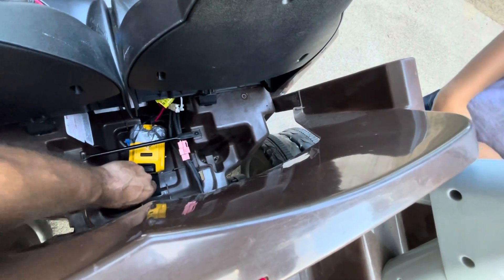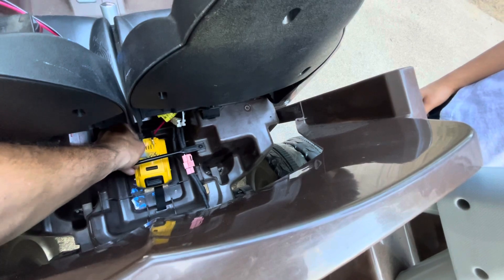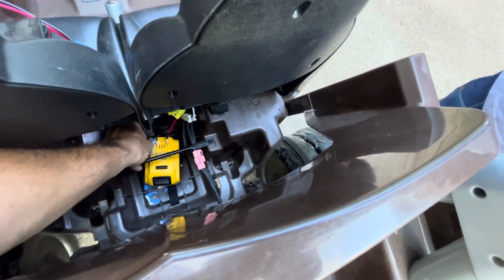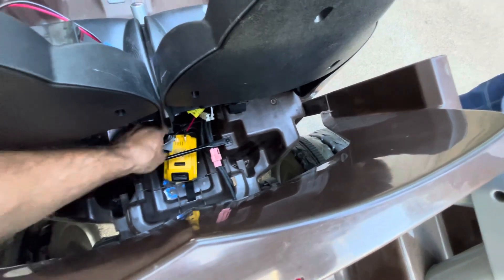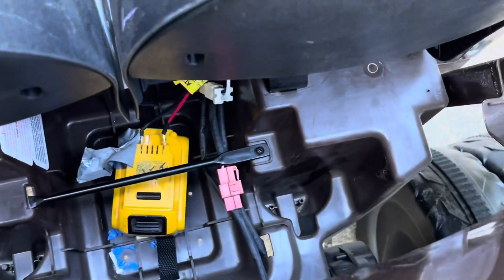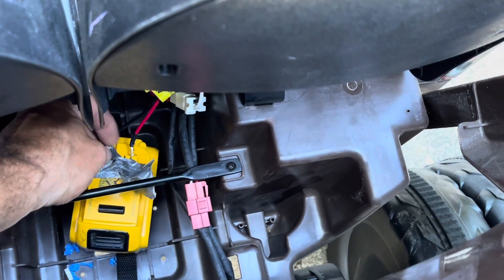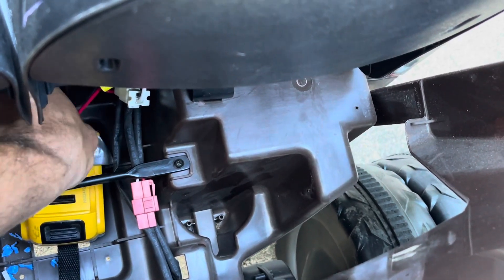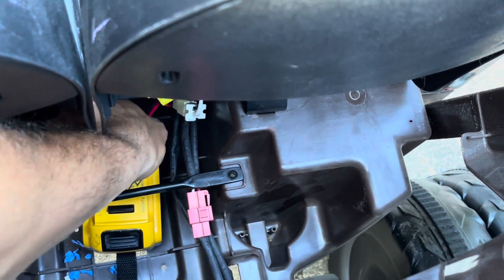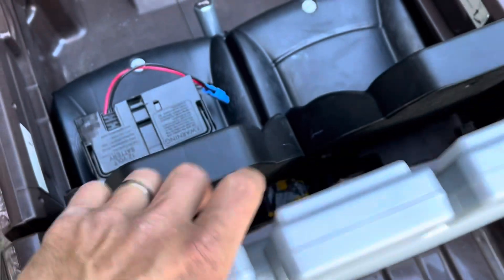You can see the pieces of where I cut that blue prong away until there were two metal bits that were perfect for sticking in the outer ends. This works with any battery — you'll see the positive and negative. All I did is slip that inside of here on both sides. Then I put a little bit of tape on there, stick it in, put some duct tape to hold it all together and make sure it can't slip out. Also cover up the other terminals so water doesn't get in there. Put that together, stick it in place — it's ready to rock. And then I can recharge that battery when it goes dead again.